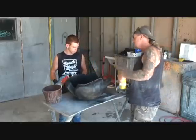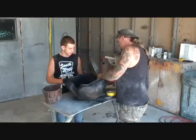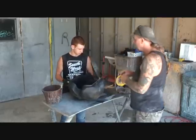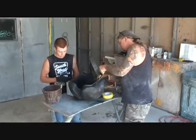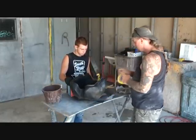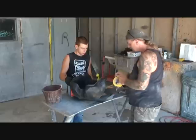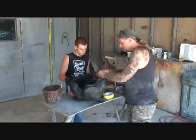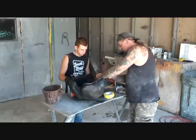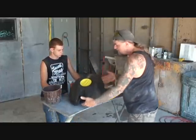This is an aircraft stripper that we're using. It's very dangerous — it will get in your eyes and blind you, and it will get on your skin and hurt you. The first thing you do is tape everything off that you don't want stripper on. The stripper will not stick to the masking tape. We also taped off the opening where the gas cap goes so no stripper gets inside the tank. We're not going to strip the inside — we'll sand that since it's underneath and we can't see it. But we are going to strip the outside.